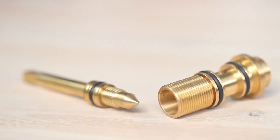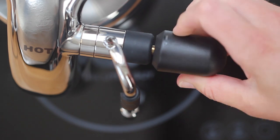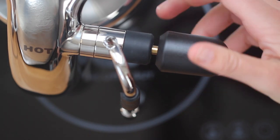It's not leaking, it's just a little bit of remaining condensation. After you've finished giving your steam wand a nice big purge at the end of a cycle, it's important to make sure that your steam wand is closed off completely as the machine cools down. That ensures that the two brass parts I'm about to talk about remain in a sealed position as the machine cools down. If you undo your steam knob, you'll see the steam pin.